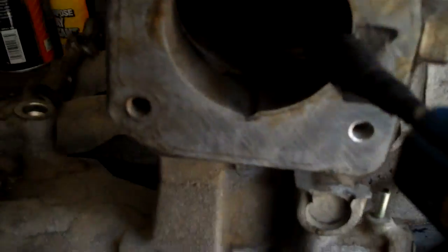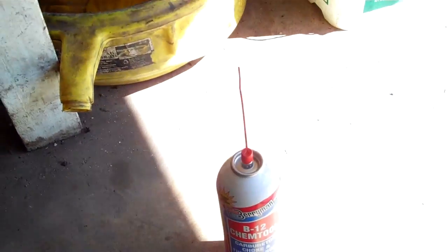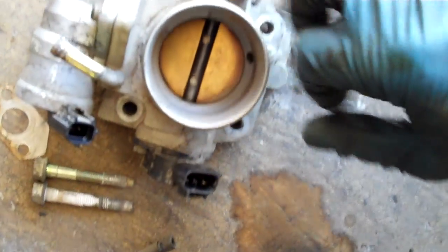I've been doing that to get it to break up. It's like when you do dishes — you pre-soak. That's what I'm talking about: pre-soak it with the stuff, blow it through with compressed air, and then repeat. Before you know it, that thing's going to be clean. Speaking of clean, look how much better all of this looks, including the throttle body — looks way better. So that's our fix.